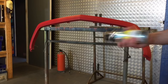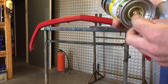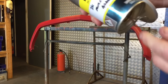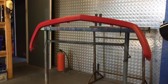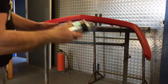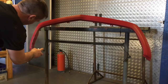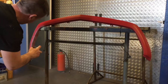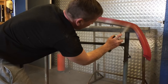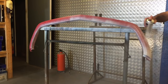That's the 2K from Kemp's Paints — it's matched to the Mercedes Sprinter colour. Take the bottom of the can off, pull that rim-pull key ring through, and that activates the can. Give it a good shake to mix the hardener in. I'll probably just give it a couple of dust coats first and then really hit it. You can see it's covering up that red almost like it's covering primer — absolutely brilliant, saving us a heap of work.